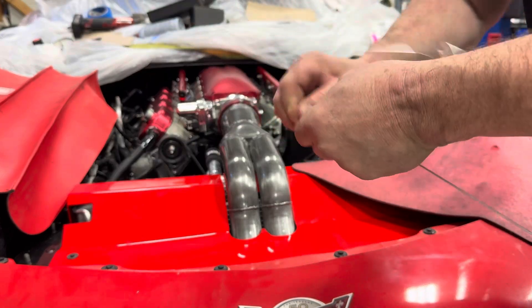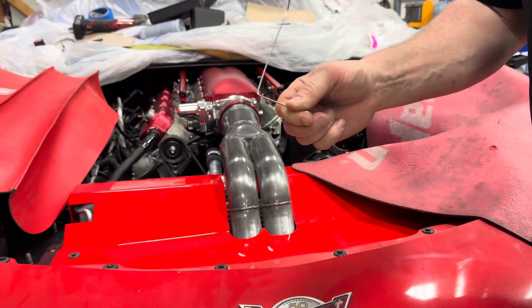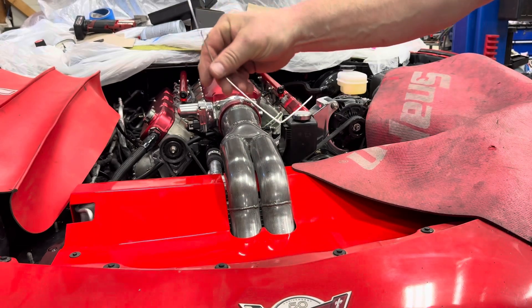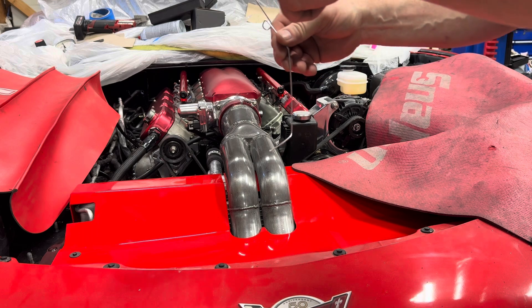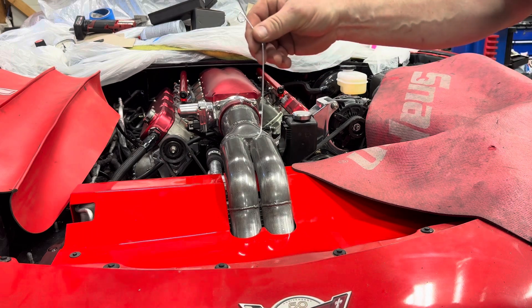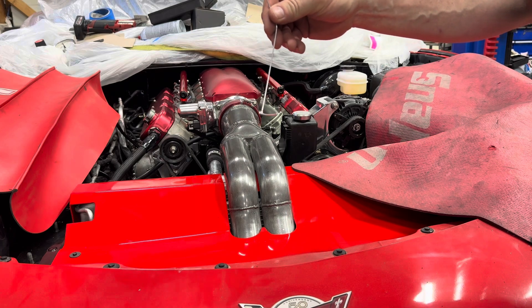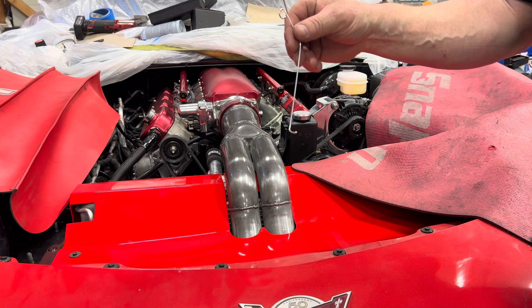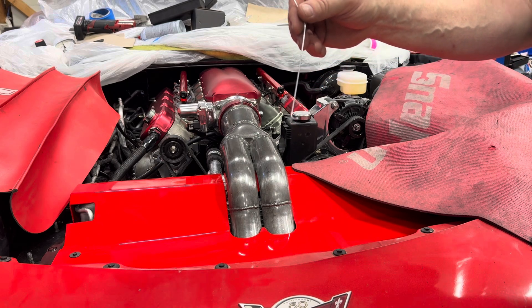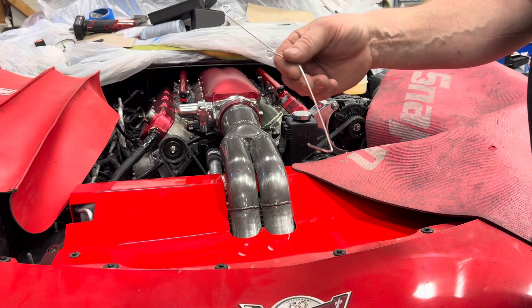You end up with something like this — this would be your pointer. You bolt that and that to the water pump, and then you'll tweak this down on top of the balancer. This is only temporary so we can get the engine timing set up. If you've got a larger balancer then this will just be shorter, but this should all work perfectly fine.